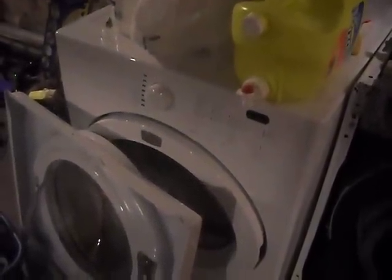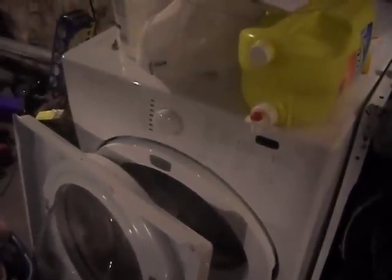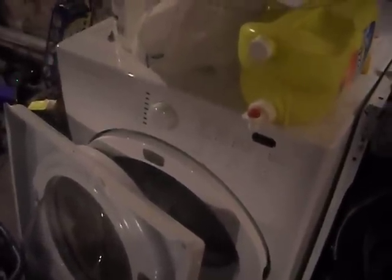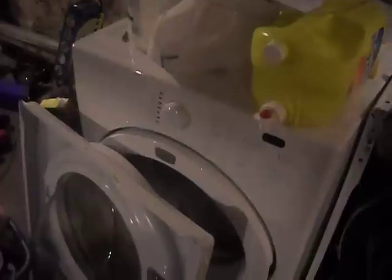The dryer, which I have the matching dryer for this, I just got done cleaning it out last week. Took it all apart and really cleaned it out, and it's drying much better than it was. Of interesting note, which you'll see in some of the videos on the dryers, if you do take them apart, it's always a good idea to pull the drum out and pack some grease back into the bearing. Mine didn't have a lot of grease left in it, and it was making just a little bit of noise before I took it apart, and it's a lot quieter now.